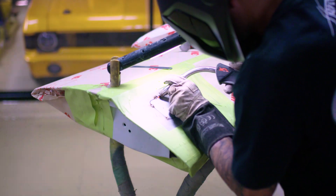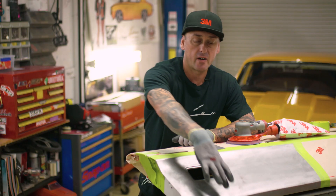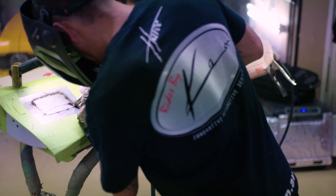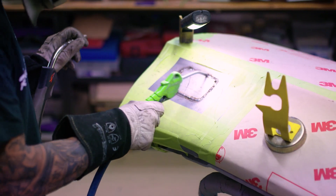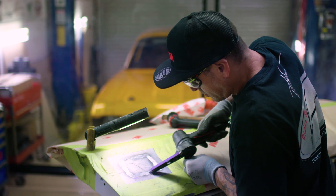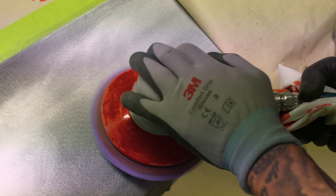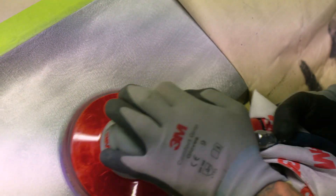If you've got any lows, you need to fix that now before we install our new handle. If you've ever welded in this section of the door before, you know that being this far in and down in the door, it's prone to warping quite easily under any heat from even simple welding, no matter how careful you are. So it's really important to get this area exactly how it would have been — dead straight — so that when we do install our new handle, it doesn't create any problems, lows, warps, or whoops in the steel.